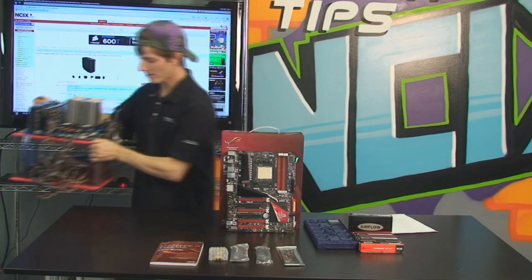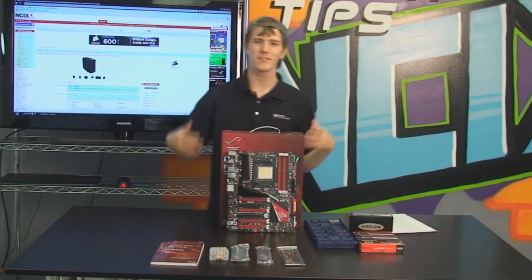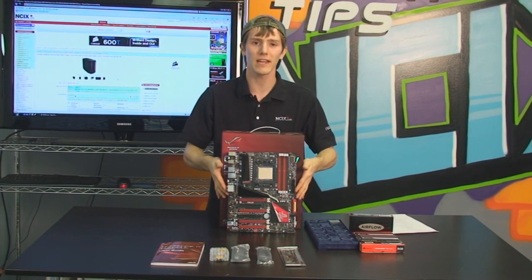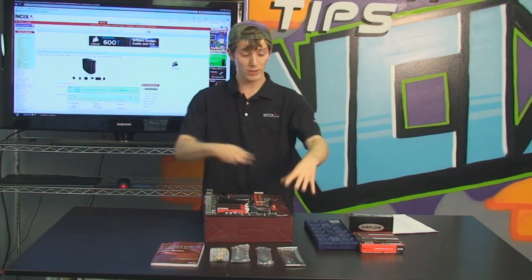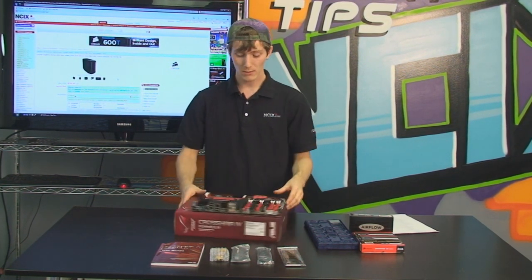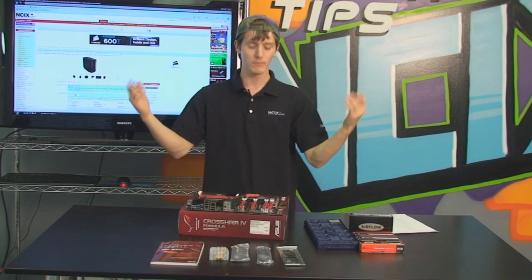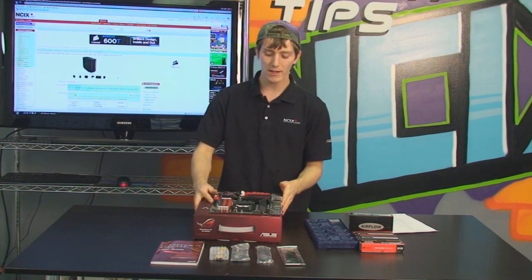Now, not everybody has $100 to drop on a tech station, so as part of my build guide, I'm going to be giving you guys some tips and tricks, best practices along the way. Here's how to make your own tech station when you're building your machine. Take your motherboard box. Do not put the anti-static wrapper on top of it. Put your motherboard on top of it at the edge so you can hang any cards over the side, and boom, there's your tech station. Motherboard box, perfect mobile tech station.